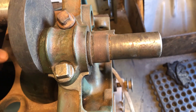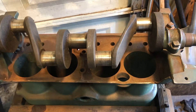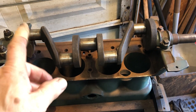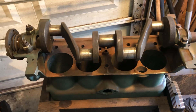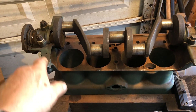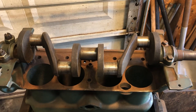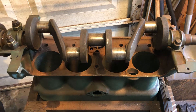Here's what the snout looks like here. I'll clean those up as well. So I'll do a little work on this and then I'll show you what things look like. As with the other ones, I'll do the connecting rod bearings and the center main bearing first. Then I'll swap the rear main bearing onto the center to help support that, and then I'll clean up and polish the rear. Then I'll take the front main cap off, probably flip that back over to the rear so that I can do the front. And I'll show you what it looks like when I'm all done.